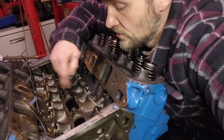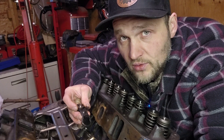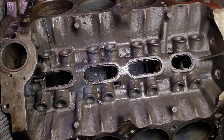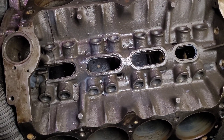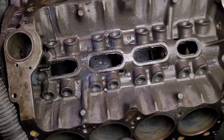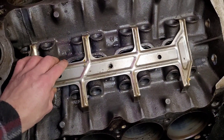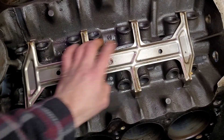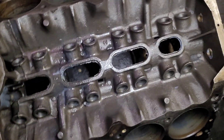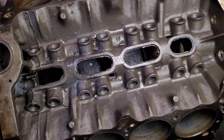It is possible to convert, but you'd have to be drilling and tapping holes. This 1986 Chrysler 360 came from the factory with a flat tappet cam - same engine but five or six years earlier. As you can see, this block doesn't have the bolt holes for the retaining plate, so it would have to be modified in order to convert it to a roller cam setup.